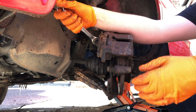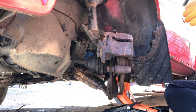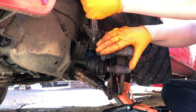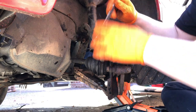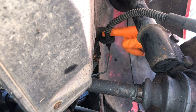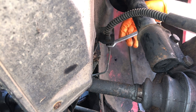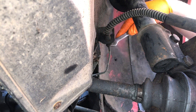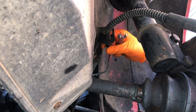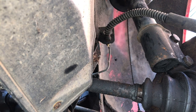There's brake fluid everywhere — let me try that again with a 15mm. There we go, that's broken loose, which is ideal. Now I need to disconnect this brake hose with a 13mm spanner. That's coming undone nicely. Yep, that's going to be leaking and dripping everywhere — a nice mess I'm going to have to clean up later.